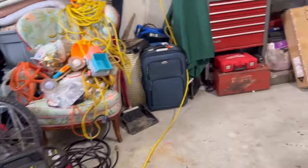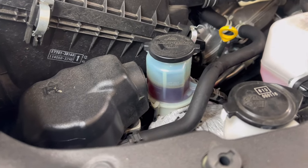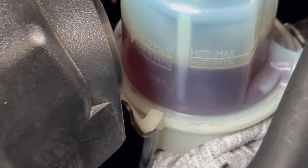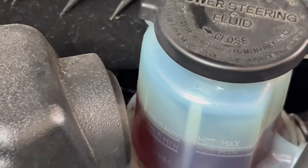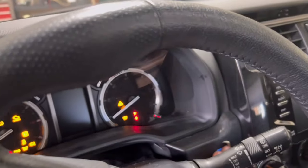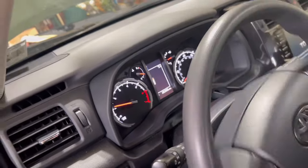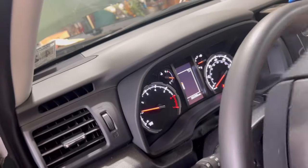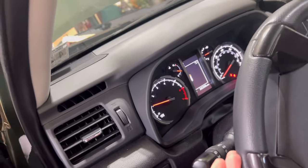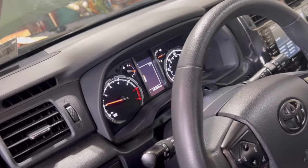Let's just see if the fluid level has dropped at all — you don't want to run the stuff dry. As you can see, it dropped ever so slightly. Let's bring the level up. Once you've done so, let's go ahead and try that again. This time around we're going to turn the steering wheel clockwise and counterclockwise. Let's go ahead and start the car, and just like that you're going to bring it to full lock on one side, then the other side. You want to repeat this process at least four times. Bring it back to center and turn it off.